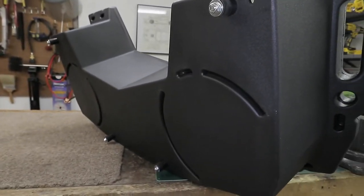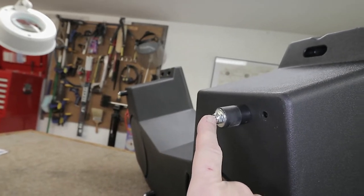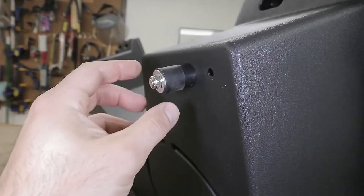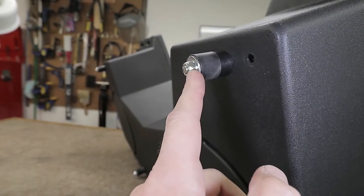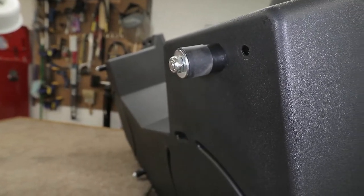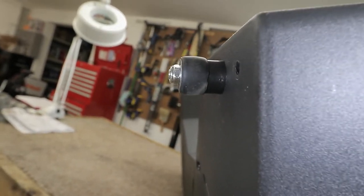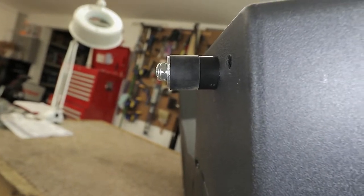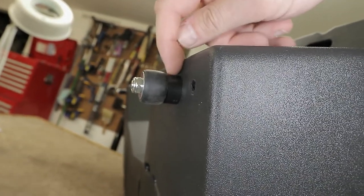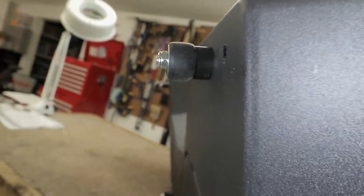I went ahead and installed the expansion anchors. Some people have trouble with these because they don't understand that you have to adjust the nut depending on the manufacturing tolerance of your machine's rack. Some machines might have a larger hole, some smaller — that's why you adjust the nut. I have it adjusted so the threaded part is just sticking out of the lock washer and nut. You keep adjusting until when you throw the lever on the inside it squashes down and has a good fit. The soft rubber is what you want inside the lock-and-ride anchor on your rack — the hard black nylon plastic faces up against the box.